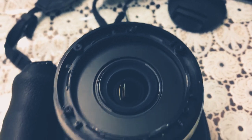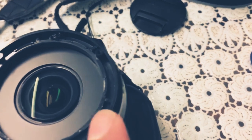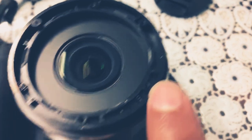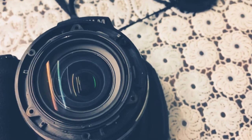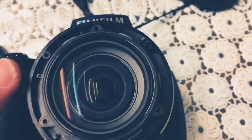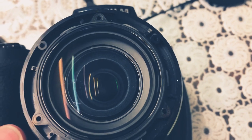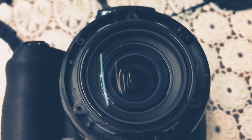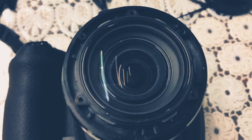What you need to do is put these springs back on these three little holes, not the big holes, the little ones. And there's a little sort of raised plastic part which will guide it. Okay, once you're happy with the cleaning, you can put the outer lens back on top of the spring mounted body, and just make sure you put it back with those marks you made before, so that everything is in line. You can put the screws on next.